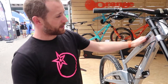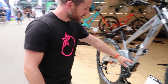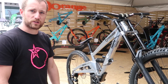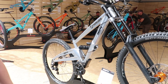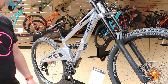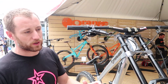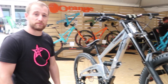We're playing around with adding the weight low here, and also looking at putting it higher up to help out with the fork. Those weights are coming in at basically a thousand grams, but we're also looking at different size weights — you don't have to run them all, so you can make it suit the track. The reason for that is stability and changing the ratio of unsprung weight to sprung weight on the wheels. By altering that ratio you can change the feel of the suspension — in simple terms, if you add weight to the frame it makes the wheels feel lighter so they can move out of the bumps.